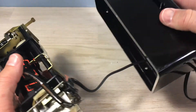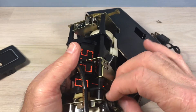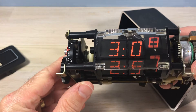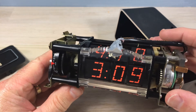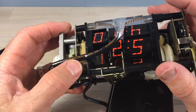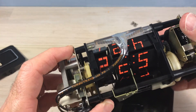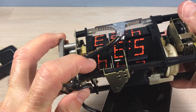Unfortunately, unless you take the cord off or cut it, you just have to clean around it. You could desolder it here if you wanted to — I tend to avoid that, no sense in extra heat for no reason. So we're looking at this cool little mechanism, and I just love these Chronotel GE mechanisms. They're fascinating — like little Ferris wheels in there. It's a little more complicated than a flip clock, but there is flipping going on.